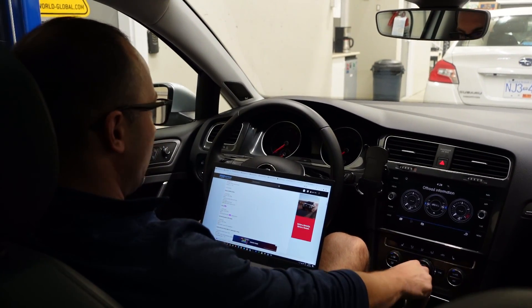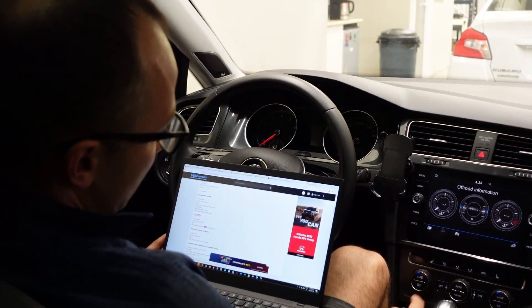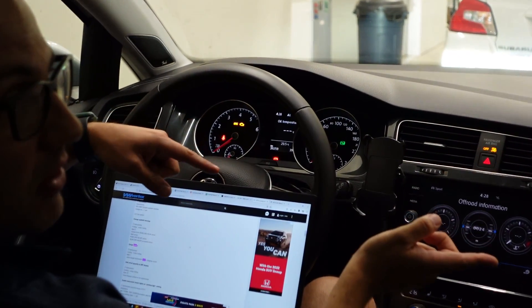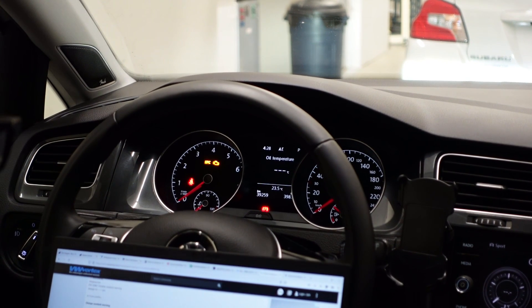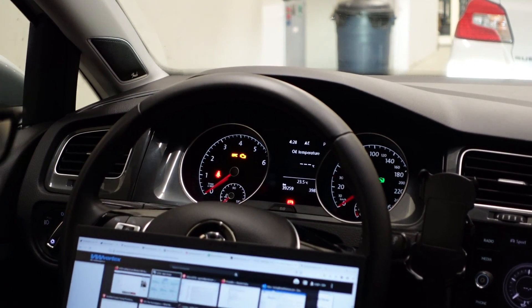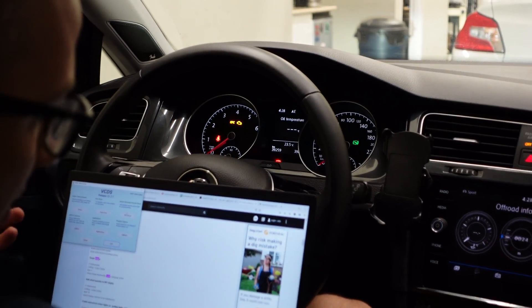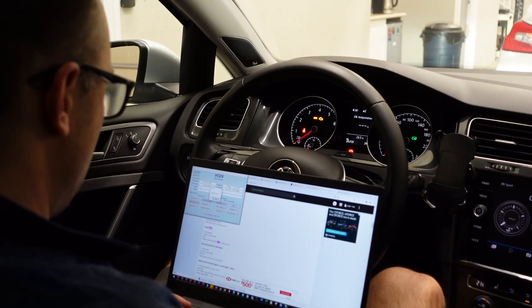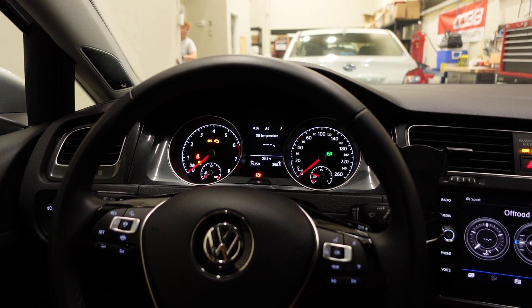One of the things we all love is a good gauge sweep — there's nothing like it to get you ready for some performance driving. The way it usually works is you hit the start/stop button and your tachometer and speedometer sweep forwards and backwards and come right back. This car does not do this from the get-go. So we're going to search VW Vortex for gauge sweep coding — and it looks like we can do it right here. We've connected the VCDS OBD dongle to the laptop, selected the module we want to program, coding accepted, go okay. Now check this out — ooh yeah, now that's sporty.